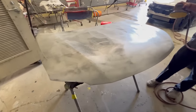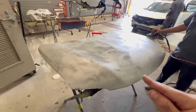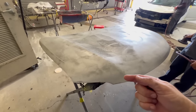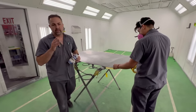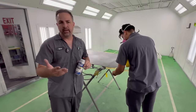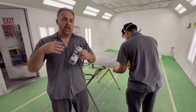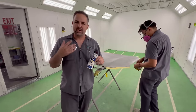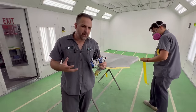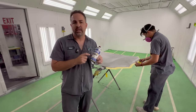This has all been sanded with 180 grit and it's a little dusty still. Now I'm going to talk to you about how we're going to protect that metal. It's so very important - as soon as you've got it all sanded down to metal, protect it immediately. We brought it into the booth. At this point it's best to really limit your contact, so when you touch the panel and clean it, make sure you're wearing gloves - you don't want fingerprints all over the panel. Since this is a do-it-yourself and professional-level channel, I'm going to show you something you can use at home.